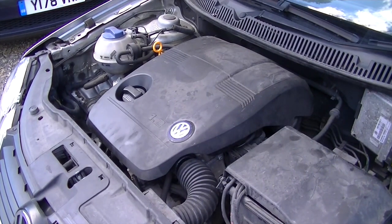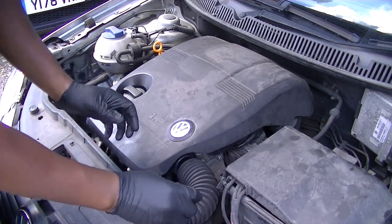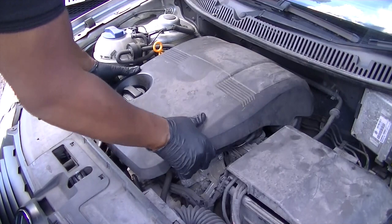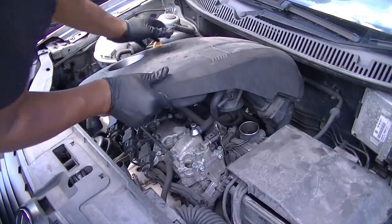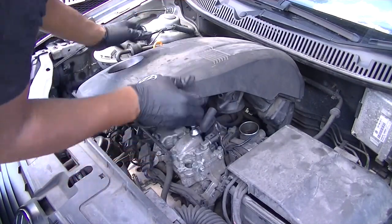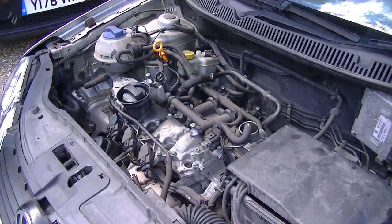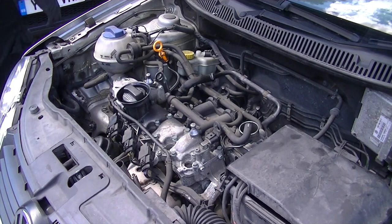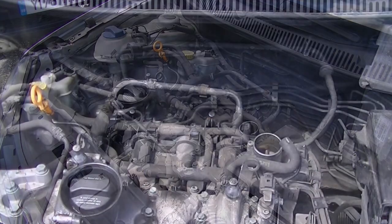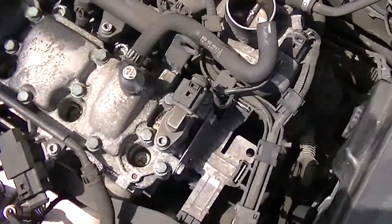In this video we're doing a decarbonization using water, but I'm actually using a cleaning fluid this time. A subscriber asked me because it's a little bit different on these cars. Just lift it up, remove some pipes that go onto the underneath of the actual filter itself. When you're doing these sort of cars you have to get the cleaner into the intake, the throttle body.